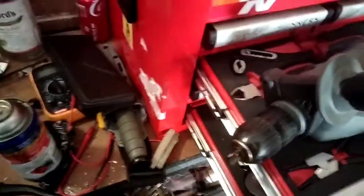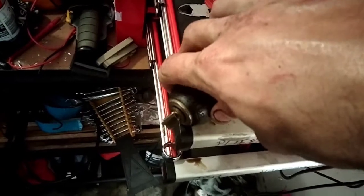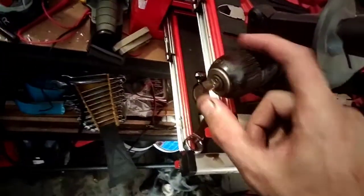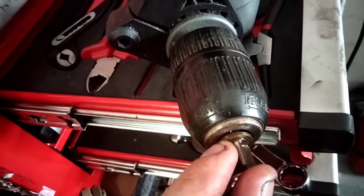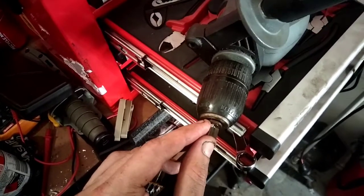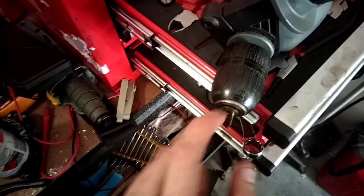Alright, I think it's worth doing something. Sadly I don't have a metal lathe. I've got a drill — I'll put that in a chuck and with some very very gentle sandpaper, maybe even some dish scrubbers — this is just brass, so that'll be fine. Poor man's lathe. I'll try and face away this little ridge down in here. If I put it back together and this is leaking even a quarter of what it was before, it's going to put it in my head that the rest of the motor's gone. This needs to be done well.